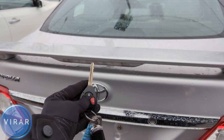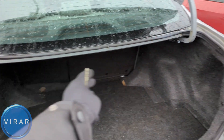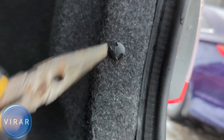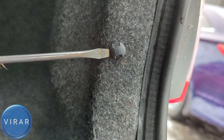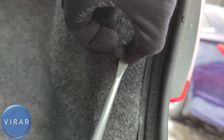Now let's go ahead and get started. Go ahead and pop the trunk. Once the trunk is open, the process is the exact same for the right side and the left side — I'm just going to show you on the right side. Now there are two clips: one over there and the second one on the top. We need to get them out, so use your pair of pliers and just grab on the clip and pull it out straight, or you can use a flat head screwdriver and get the clip out halfway through.